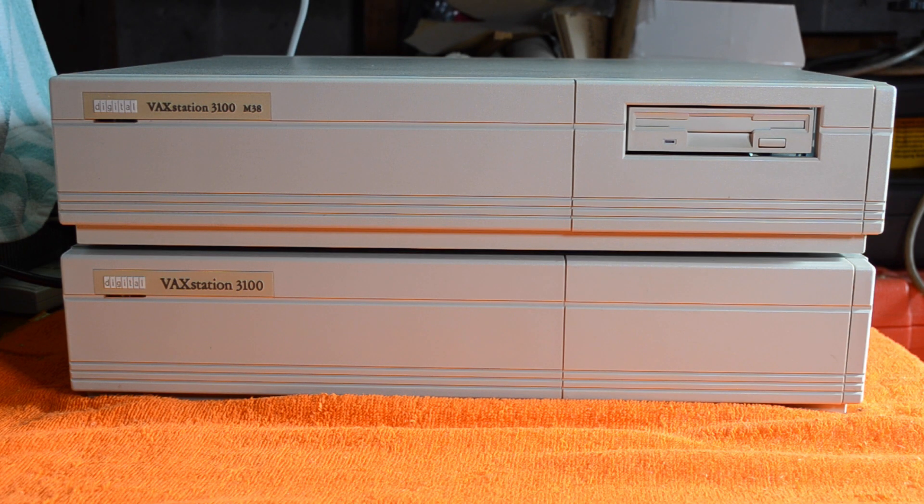Hi and welcome back after a long break. Still very cold in my garage at the moment, so if you hear a heater in the background that's what the noise is. Today I'm going to look at the graphics on a VAXstation 3100 on my model 38 here. The VAXstation being a workstation is meant to have a CRT on it — a VR262 or 290-something for display. Often those get lost when you get them second-hand. Most people run them just through a terminal, but today I'm going to attempt to get the graphics working so we can have a look at DECwindows running direct, and not through something like an X Windows client like Excursion.